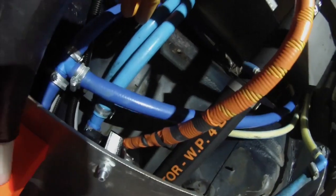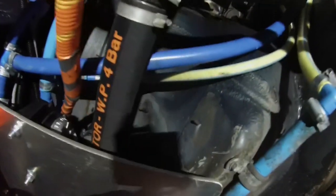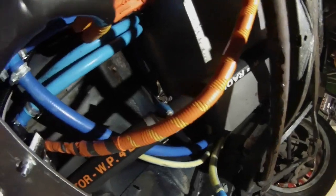Up around here, let's get a bit more light up here now for you to see. Hopefully this is kind of what I call plum crazy in here. This is where all of our pipe work for the heater and for the cooling system kind of come together. Now let's see if I get you some light up there. Hopefully you'll be able to see in some fashion anyway, without turning yourselves upside down, where the cabin heater pipes, those blue pipes up there, go up and then they come down and go around and into our heater, and that's our little water pump there for the heater system.